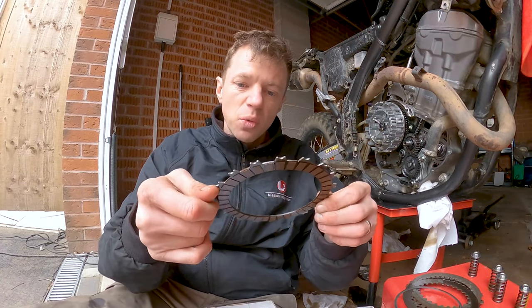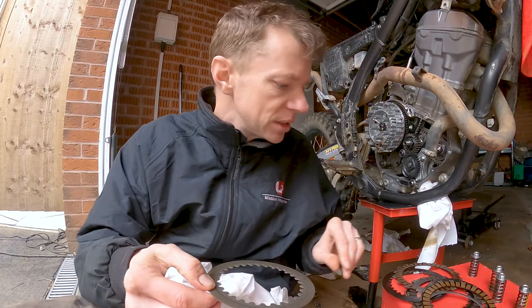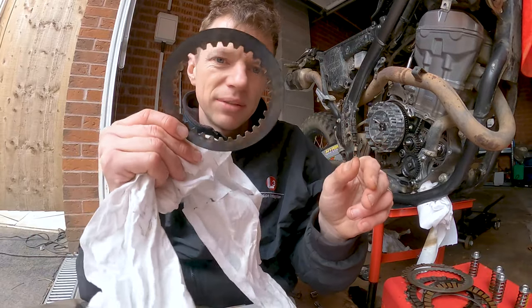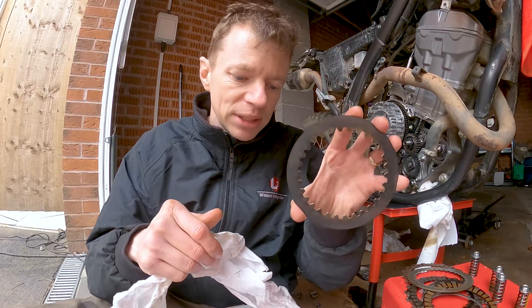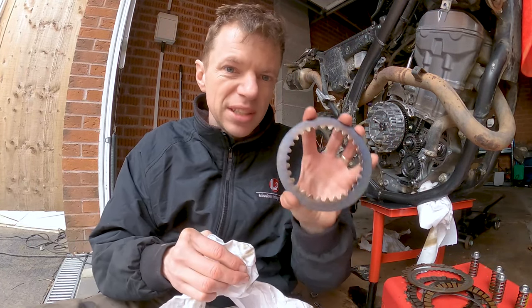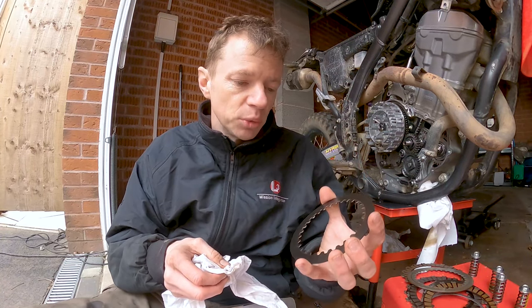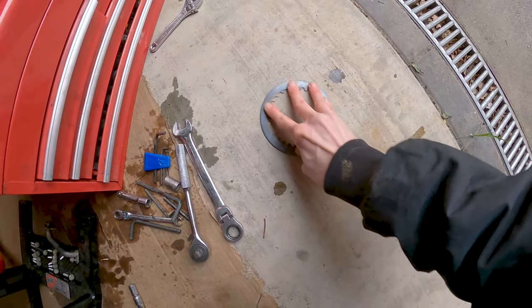I'm just going to wipe mine down with a smear of oil. I'll also take the time to inspect the steel plates going back in — there's some discoloration on a couple of them where the disc has got hot, so I know I've got hot spots in my clutch. To get these back to a standard color I'm going to rub them on a concrete floor — I saw it on the internet. As long as they're not bent, they can be scratched up because that's the deal with them — they need to grip things. I seem to have one of the smoothest garage floors ever, so it's just gently polishing rather than roughing them up.